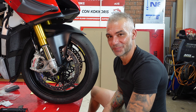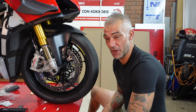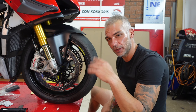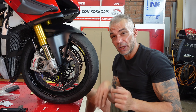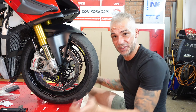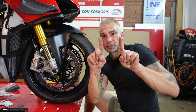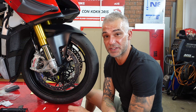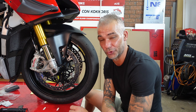Why are we doing that? The spacers to the boot of the front suspension and to the rim have a tolerance that allows play there. In order to have a straight line through both forks, if we don't play with it by pushing in and tightening one side then the other, instead of being straight it might sit at a slight angle. If the fork is on an angle, the front suspension doesn't work properly — and on a superbike, that's serious.